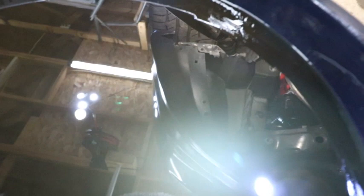So we're going to take a look here at the oil. I'm not sure if you can see it, but there are a few little metal particles — it's to be expected because it is a brand new block. But it's really not too bad. So I have drained the oil. Hopefully you can pick out the metal particles in it. There wasn't a whole lot.